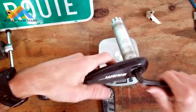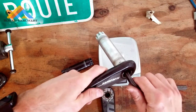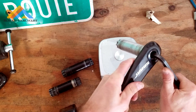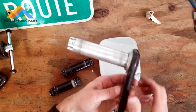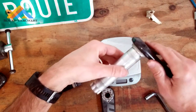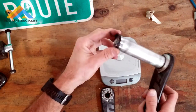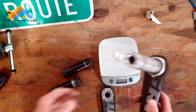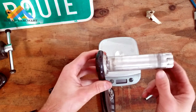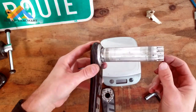I have not had any issues — been doing this for years. So it's tightened down real tight and it's ready to go. Now what you'll do is put it into your frame. You'll use any kind of BB30 spacers and you can space it out. You don't have to worry about a GXP being too small and trying to get it wide enough and all that stuff.